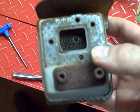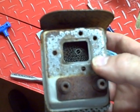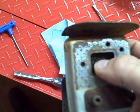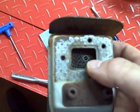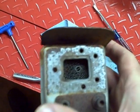A lot of these small engine mufflers are really hard to clean — it's just better to replace them, and they're not very expensive. If it was carboned up, you could perhaps lightly tap it with a hammer to try and break the carbon free, then take an air hose and blow it out.